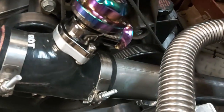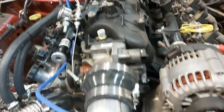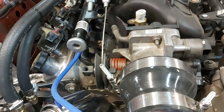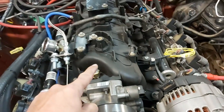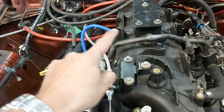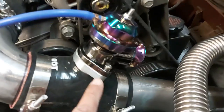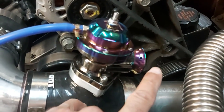When we have boost going into our intake track, this tube, the elbows, and the intake manifold are all pressurized. When we close the throttle — foot off the gas — that pressure's got to go somewhere. Our whole intake track is pressurized but our intake manifold goes to vacuum because the pistons are still moving up and down creating vacuum. So we've got a vacuum signal traveling to our blow-off valve's diaphragm, which then pulls open the valve and relieves the boost pressure built up in our boost tube and system.